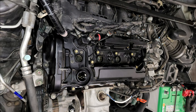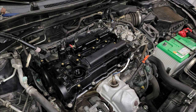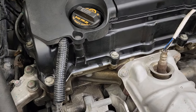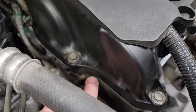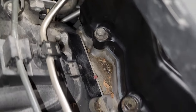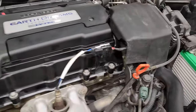You have to be very careful as you install the gasket — flip it upside down and make sure the gasket doesn't leave. A few dabs of RTV can hold it in place. I also clean the valve cover, and I recommend cleaning everything inside and out. If you have a part off, clean it before you reinstall it. You can see these little flaps around the gasket — those flaps kind of help you know that you got your gasket seated, but you do want to check to make sure you didn't pinch your gasket or get it wrapped up on itself.